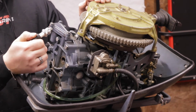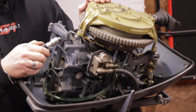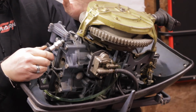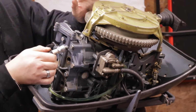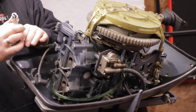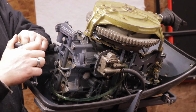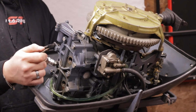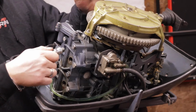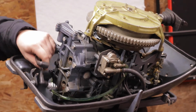And you're gonna grab your wire. You might get shocked, it's not too bad. And we're gonna hold it up here next to the metal. And hopefully you guys will be able to see this, but spinning it around, I highly doubt you guys are going to be able to see that, but it is sparking. Now, we're not looking for how good the spark is right now, obviously, because we're just cranking it by hand and it needs cranking speed to make a better spark, because this does not have a coil setup like you would normally have, but... Whoa! Yeah, so it does spark.